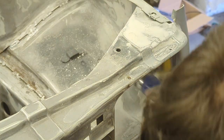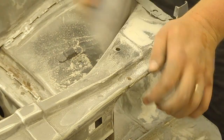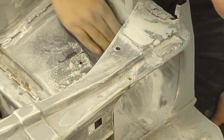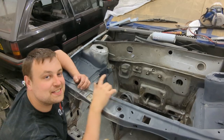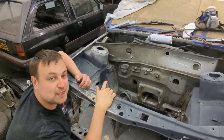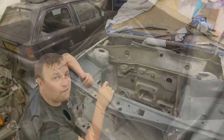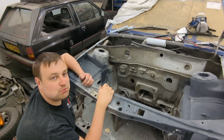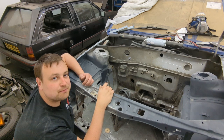High build primer covers 320 really well. However, if you're just using normal primer I'd recommend going much finer — maybe something like 500 or 600 grit. I've blown in both inner wings with some etch primer just to make sure the filler work looks okay, and it looks more than presentable. The owner of the car just wants it to be practical, usable, and look nice — I think we've achieved that.